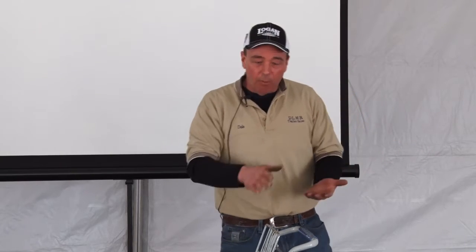That is 90% of the failure of trailer tires exploding. Everybody runs them to the maximum air pressure. What we always recommend in our service department, I recommend to you, start out with 10 pounds below what the manufacturer says. And let's say you normally only carry your horse, and it's a local trail ride. When you drive 15 miles and you get out, as soon as you get out, walk up to that tire, put your hand on the center of that tire and see if it has any hot spots across the tread. So this is my tire, round this way, and I feel it, and it feels warm all the way across, about the same temperature. You're running a good air pressure. If you get to where the center of that tire feels hot, you need to lower the air pressure. If the outer edges seem too hot, not the center, raise it a little bit.